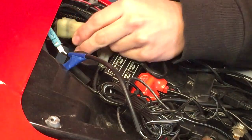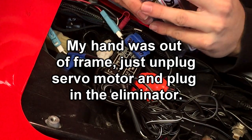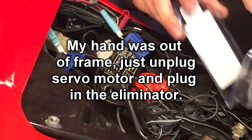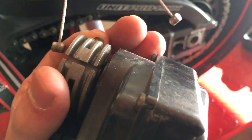And what I'm going to do is disconnect it from here, and I'm going to take my servo eliminator, which I bought at RevZilla, I believe it was $60, there's a link in the description for the CBR600RR. Mine's a 2008. All right, so I have the servo eliminator in here. Just removed my servo, this is what it looks like when it's all out. So you have these two cables in here and you just want to pull them out. They'll just slip right out the end right here.